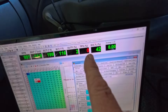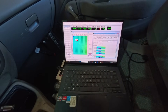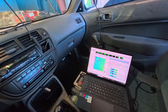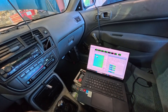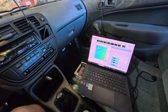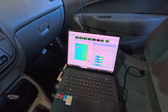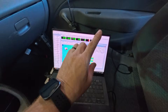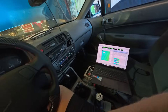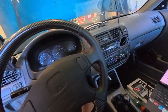Right now we're at 42% ethanol, fluctuating between 42 to 44 percent. Before the head gasket failed, we had just introduced ethanol and had the fuel curve correct for pump gas. Now after the head gasket repair, the air fuels are way too far off to move forward. The fuel curve needs to change tremendously to get the air fuel back correct. The customer isn't going to like this because it'll cost a little more, but we're going to remove the ethanol, put pump gas back in, get the ethanol percentage down to 10 to 15 percent, and start tuning over.